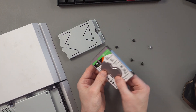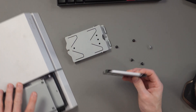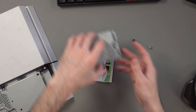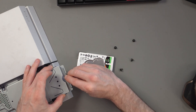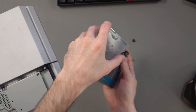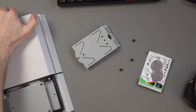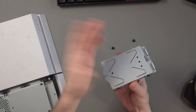So this is my replacement hard drive — the Seagate 2TB FireCuda. Jumping over to my overhead camera, you can see it's a standard 2.5-inch hard drive, with holes around the side so we can connect it to the caddy and then slide it into the PS4. These black screws were originally on the caddy to secure the old hard drive and I've simply taken them out. We connect the hard drive to the caddy with the metal casing at the top. To determine orientation, just check the hard drive connection ports — there's a long part and a thin part. Simply line it up and then you can secure it and slide it in.